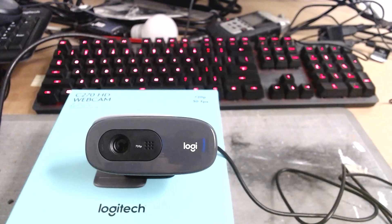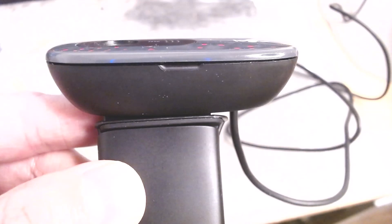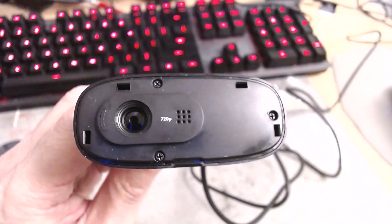First of all, you're going to have a faceplate to deal with. The faceplate has a little indent at the bottom underneath, which you can basically run a thumbnail into. Then what you're going to do is lift it to the sides where there's a little catch on both the left side and the right side of the faceplate, and you can pop that up quite easily. Then you'll see a lid that still holds and protects both the microphone on your right and the lens on your left. There are only three screws — one on top, one on the bottom, and one to the right — that you need to take apart.